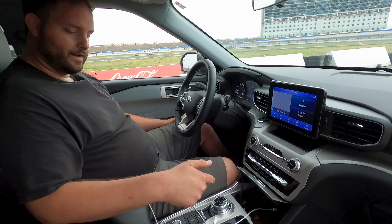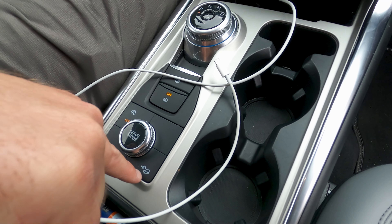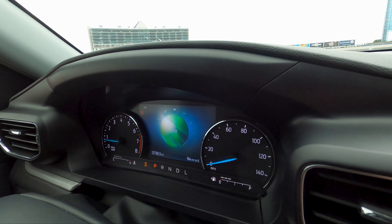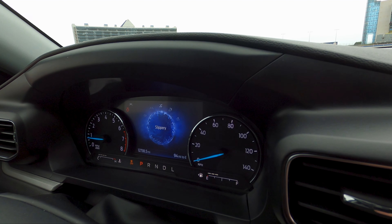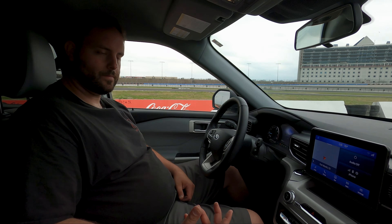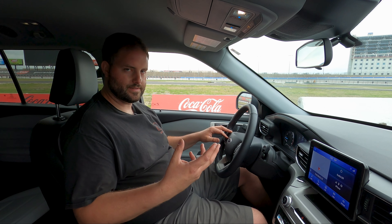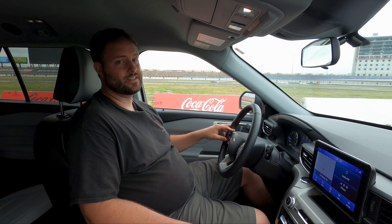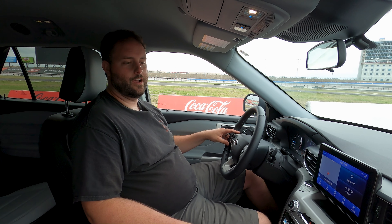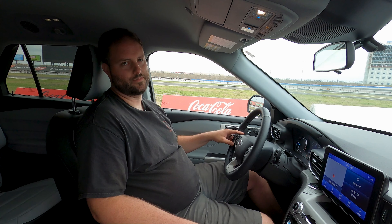You have a rotary dial for drive modes. There's auto start-stop, traction control, and hill descent control. The drive modes include normal, eco, sport, tow-haul, and slippery for inclement weather conditions. Sport is nice because it holds shifts really sharp. There are no paddles or manual gear selection, so you rely on the modes. Tow-haul is very livable with more aggressive shifting but not too aggressive. I've been driving in eco because it's the softest shifting — in normal mode it can be a little herky-jerky with the 10-speed auto, but eco pretty much solves that. Thank you for watching Texas Truck Channel — stay tuned for many more trucks and SUVs.